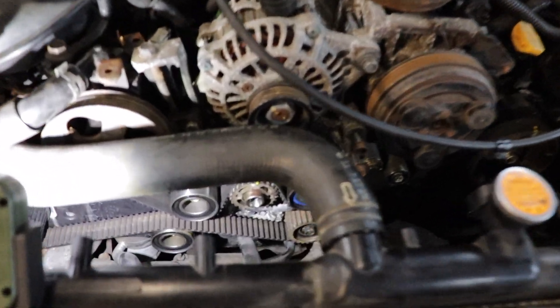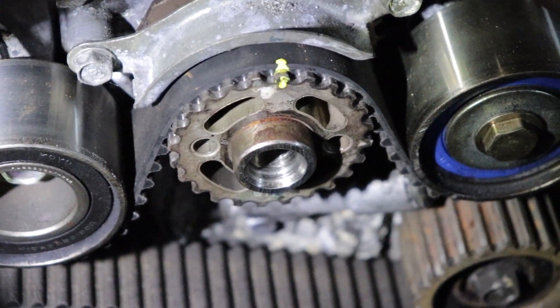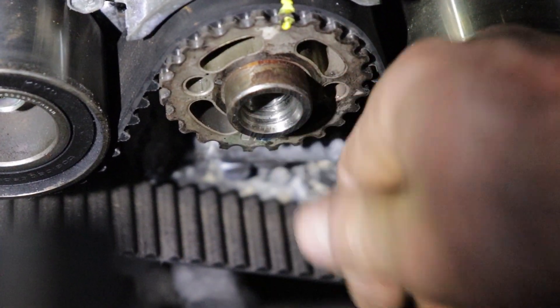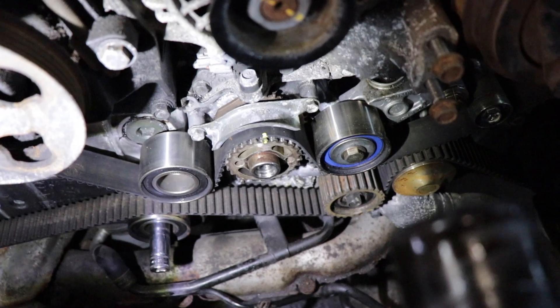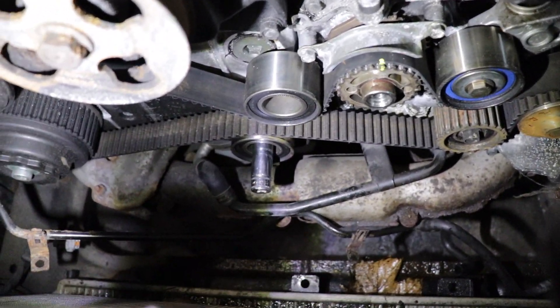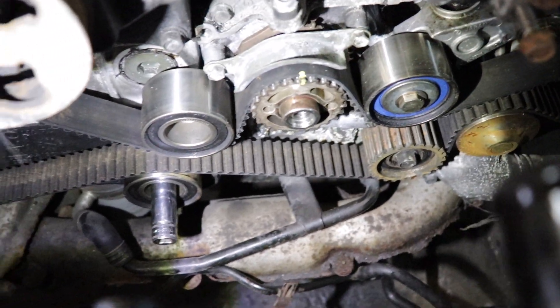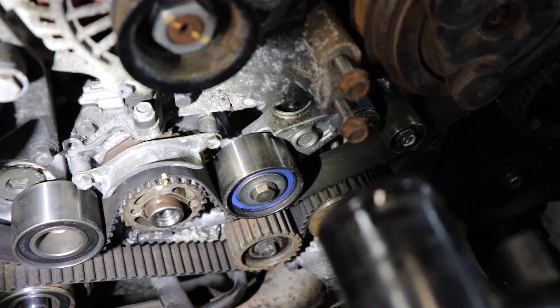It's a new day — I wasn't able to get everything done when I wanted to, but we're back at it. I'm going to be pulling this timing belt off. The crank sprocket has a mark I've highlighted in yellow, and that faces straight up when everything is in time. The keyway is on the bottom — if you feel under there, the key is sitting straight down. The only task I really have is to get that crank sprocket off, so I'll start by getting the easiest pulleys off — this one down here has the least tension, so I'll pull that first and then get the tensioner off so I can recompress it.